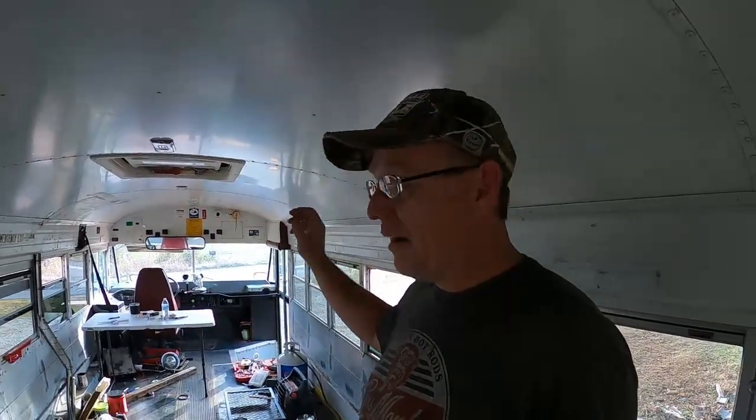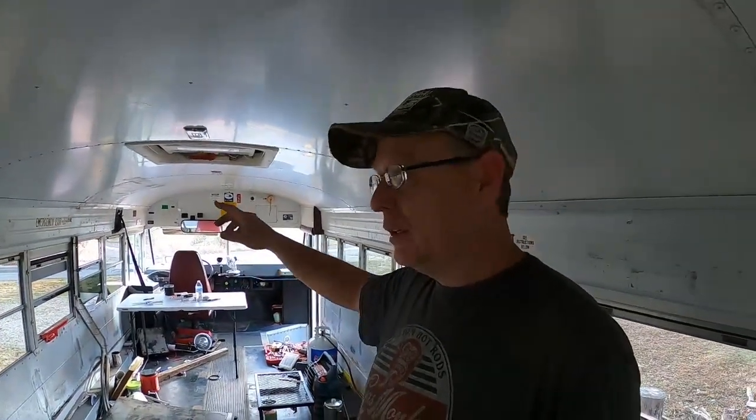Go take the instrument cluster out like we just did on this bus right here, and right where it plugs in, get that all apart and re-solder all those pins where it plugs into that, and that will fix it. That's the same thing we went through with our Chrysler Town & Country. It was a limited edition. I don't know if that really matters or not. And I heard that a lot of Dodge Caravans do the same thing. So I figured that's what was wrong with this one when I bought it.